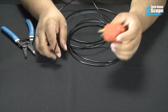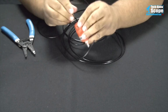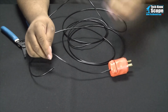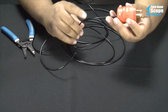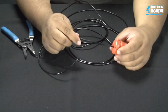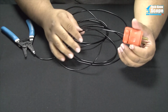Okay, so we have our plug. The wire is connected to the third prong. Got the strain relief washer in there so that it cannot come out. Everything is screwed down tight. Now, on wire color choice, I actually prefer green because in house wiring code or extension cord code, basically any housing code in the United States, the green wire represents ground, either bare or green. In this case, you would have insulated wire, so green would be optimal.